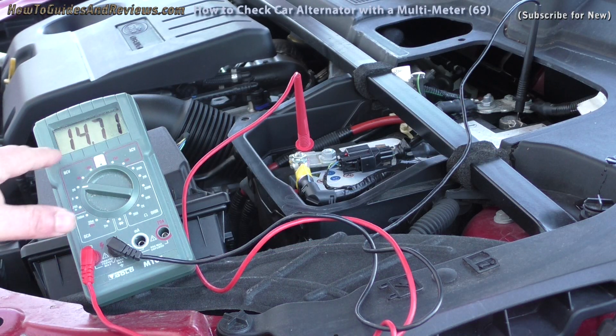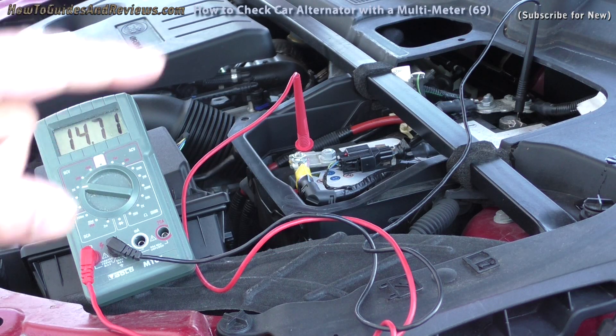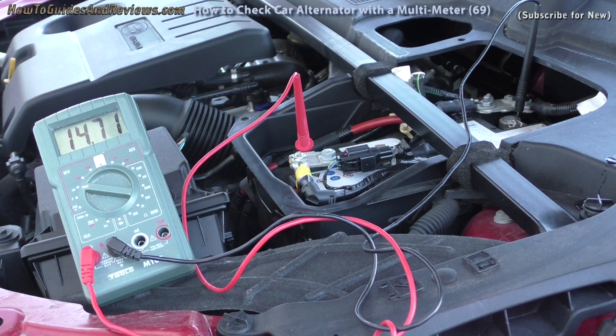So that's how you check your alternator — if it's below 14.5 volts then you've got a problem; it needs to be at least 14 volts to charge the battery. There are other checks which involve touching the alternator with the positive lead, but this is the first quick check. Just plug your multimeter to the positive and negative terminals, start the engine, and if it's above 14.5 volts and showing a constant flow — not going up and down — then the alternator is fine.